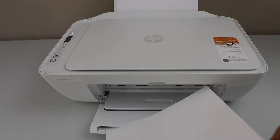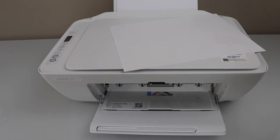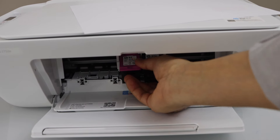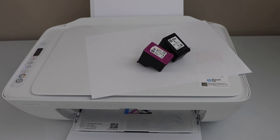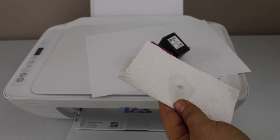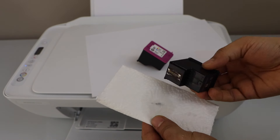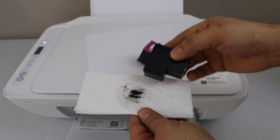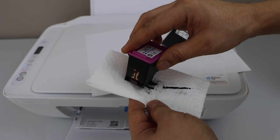The first thing is to open the front chamber and take the ink cartridges out. We have to do the printhead cleaning manually. To clean the printheads, take a wet tissue or spray some water on it, then clean the bottom part of the ink cartridges — that's the printhead. Once you clean it, it will unclog the ink cartridge. Do the same with the color cartridge.